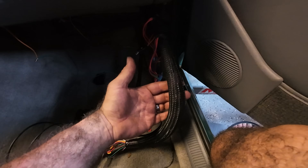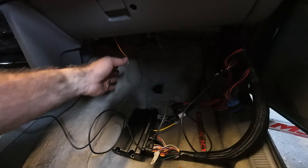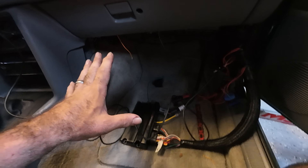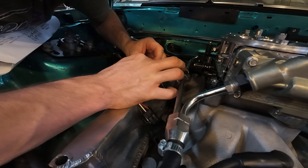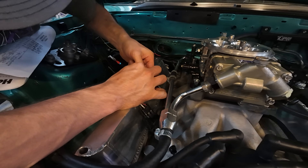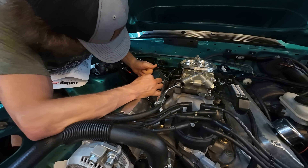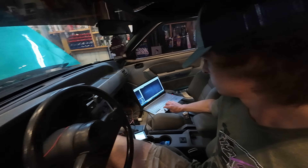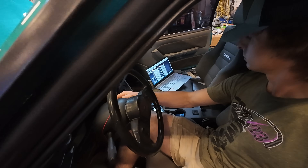There's also a green wire inside the car from your Holley harness and that's going to hook up to your fuel pump — whatever controls and drives your fuel pump, that's what it's going to do. This is all temporary, but the green wire goes to the fuel pump and you're good to go. The one thing you will have to wire in is your TPS — you just cut the wires, it's all shown in your papers, which wire goes where. Then we'll switch the key on and verify by moving the TPS sensor to see if the TPS actually moves. We're going to load up one of our files and see if everything kicks on.